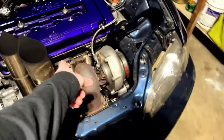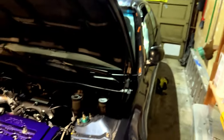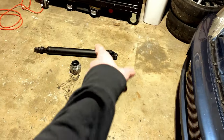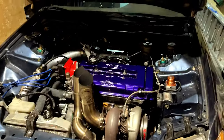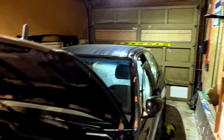Sheepy manifold that's been properly re-welded because it cracked on me about three times, CRV rear diff, Freelander drive shaft, and viscous 30k fluid — the only way to do it if you're running a CRV diff. You want to do 30k.